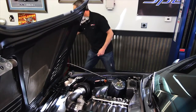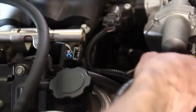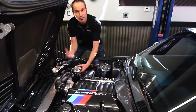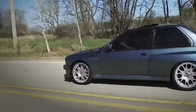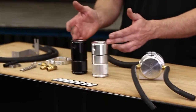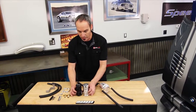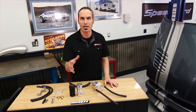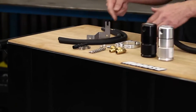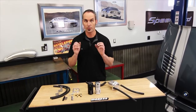I've got a great little contraption here from Moroso — an air-oil separator. All I'm going to do is get rid of that hose, pipe one end in from the crankcase, the other end back on the intake manifold, and all the oil magically gets separated out. Now I'm going with the large body setup, but you can also get different sizes from Moroso. You can put them in combination and pair them together. The cool thing is Moroso has a kit for just about any car — whether it's domestic or import. You get a specific location with instructions, all the fasteners, brackets, hoses, and an adapter. Drill a couple of holes, fasten it together, and you're off and running.